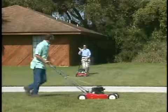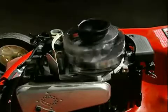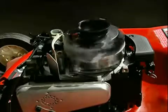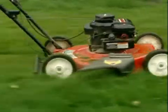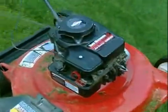By sheer number of engines manufactured, the pneumatic governor, perhaps better known as the air vane, was the dominant type used, finding use primarily on vertical shaft lawnmower-type engines. This application traditionally required little in the way of sensitivity or close speed control.